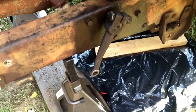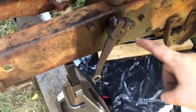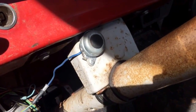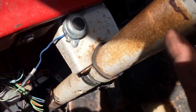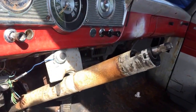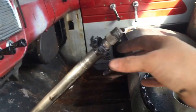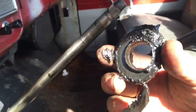This collet should come off now. Make sure you pull off your pitman arm — that's this right here. Make sure you pull off the two nuts on the backside of this plate that hold the column on. Bracket's off. Now I'm going to twist this and pull it out through the cab. There was some kind of seal falling out of there — some kind of oil seal. I'm going to throw that away.